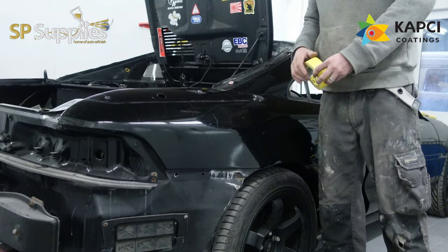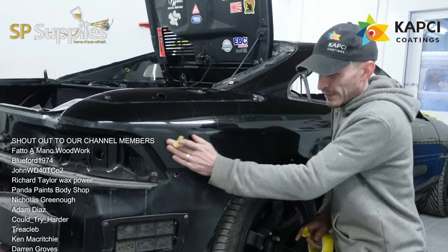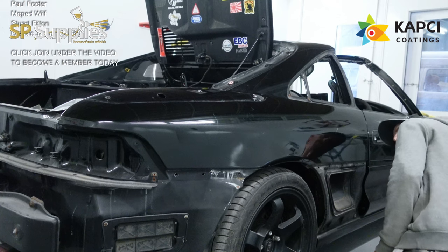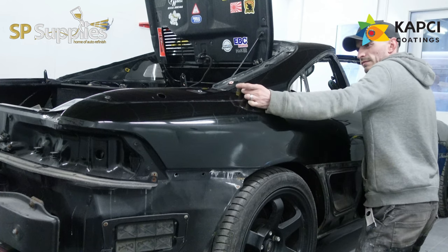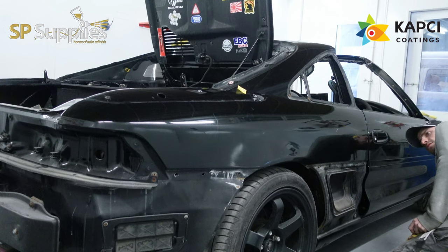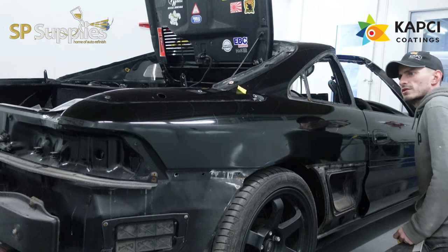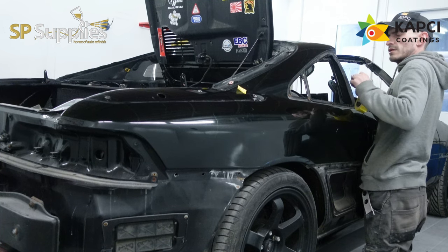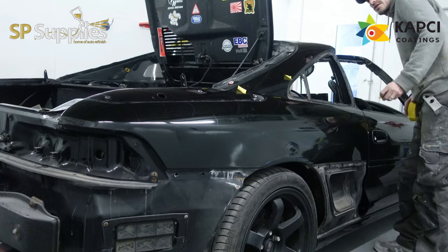When I come to approach a job like this, what I like to do first is mark out the damaged areas. Sometimes you can get a little bit too carried away going across the whole car and sanding it all down, then losing track of where all the dents, dings, lows and highs are. So I like to go across it panel by panel. I'll take a little bit of tape and give it a real good check over, using the fluorescent light bars — as I'm moving my head up and down I'm moving those light bars across the body to show up any highs, lows, or areas that need work before we start sanding anything down.